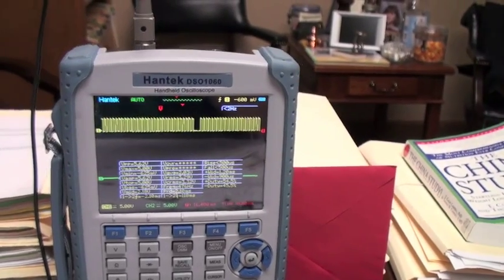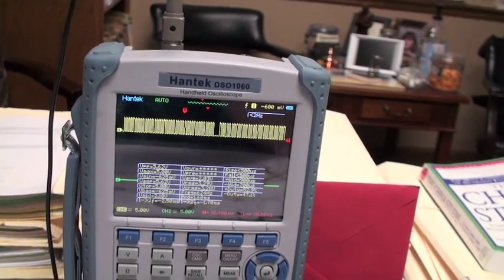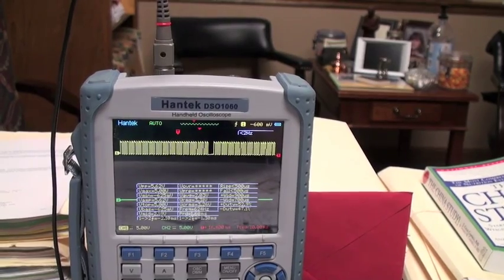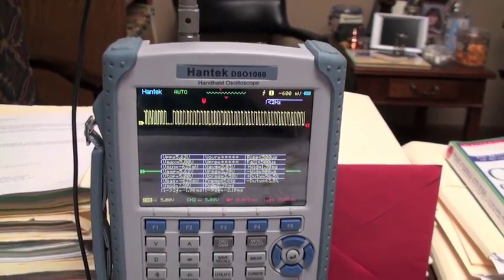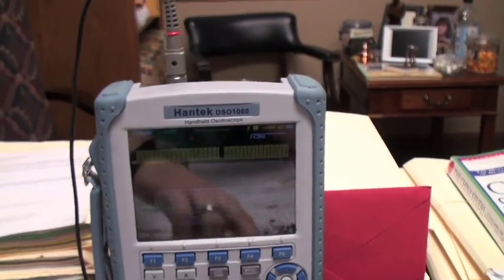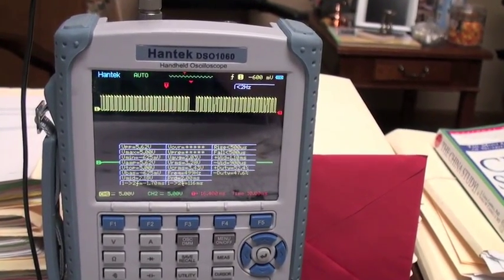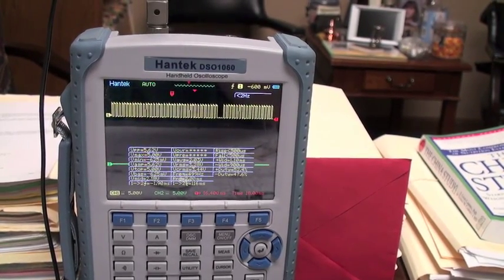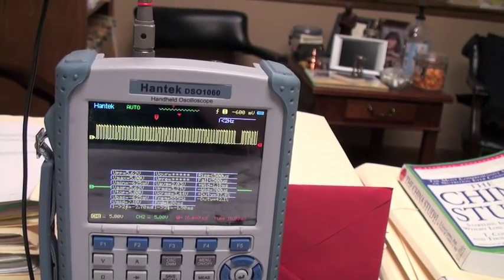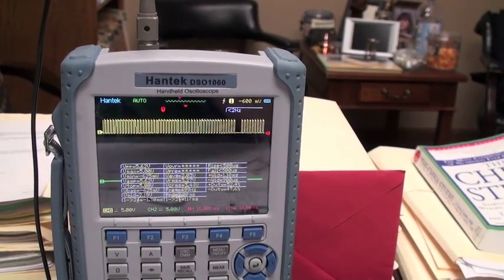I've got another sketch that Damian sent me that has not only the 60-minus-2, or 58-tooth 5-volt pulse, but it's also able to take a 2-pulse TAC signal and convert it into this 58-pulse output. So what I'll be able to do is put a 2-pulse magnetic TAC signal to this off of the end shaft of my motor — I'll just put 2 magnets on the end of it and a little sensor on the end of that to send out the 2 pulses — and that will give me a TAC signal that my ECU can now understand. And it should let the X5 ECU — or DME in BMW speak — come on.